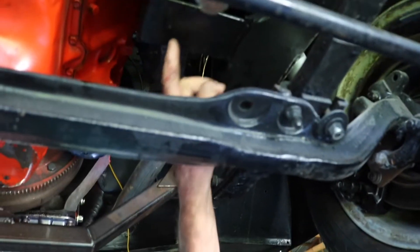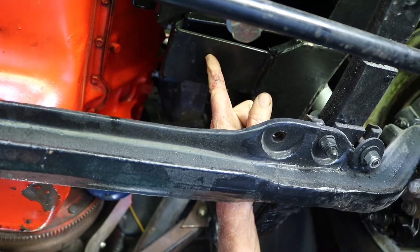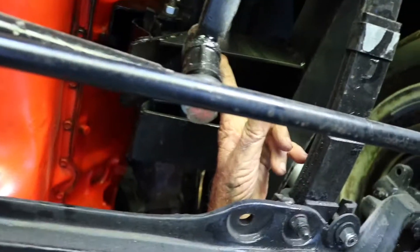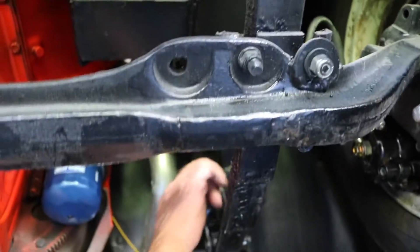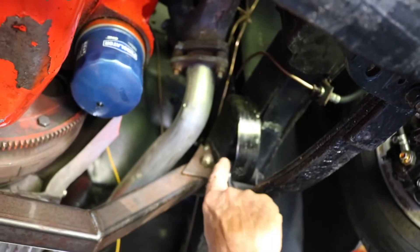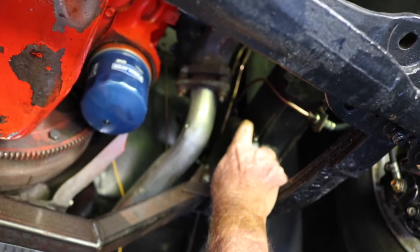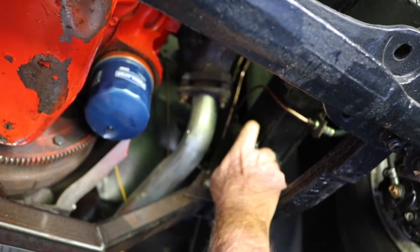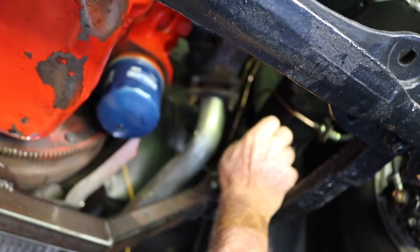This is the motor mount for the Ford 390, and then I built these mounts for the 283. I also put these straps on here to hold things in the event that a shackle comes loose from the box — this will give you a little bit of time, a little bit of a safety margin.